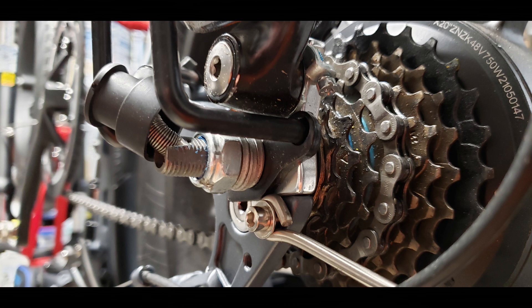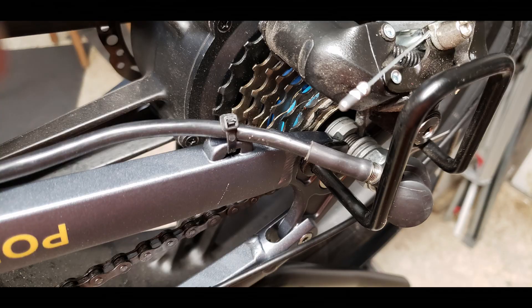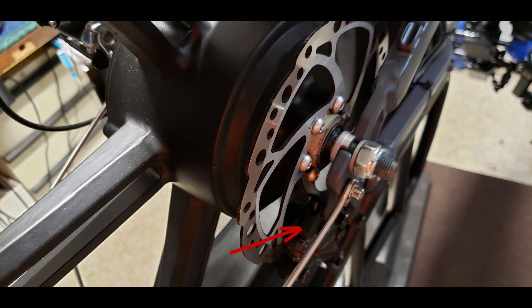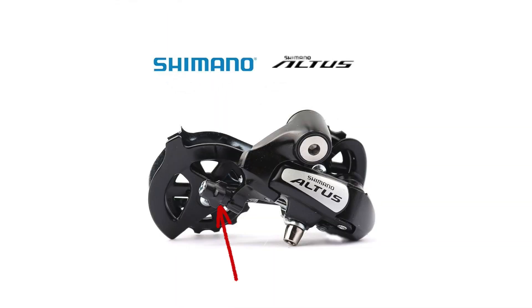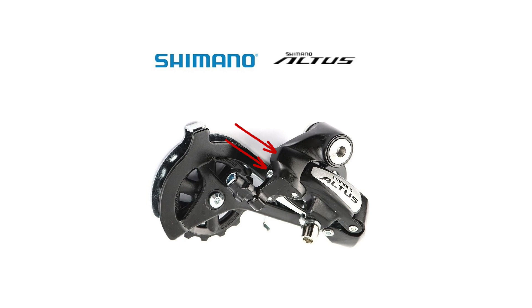It's time to put everything back together — simply do the reverse of taking it apart. Align the motor hub axle: if the bike is upside down, the wiring slot should be facing up. The axle has two flat sides that must be parallel with the rear fork blade openings to slide into place. Make sure the inside washer has the slot pointed up, and all other washers are in the same order as when removed. Take caution to align the brake disc to the brake pads in the caliper. Tighten the axle nut to 300 pound-inch — if you don't have a torque wrench, just tighten it very firmly. Reinstall the bike chain; you will likely need minor derailleur adjustments. I've left a link to the Park Tool video on adjusting the rear derailleur.